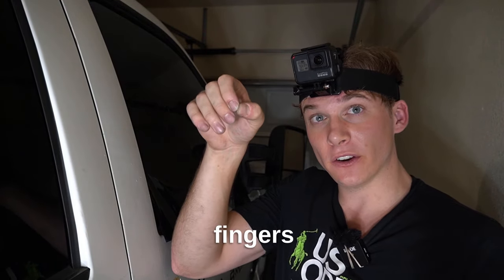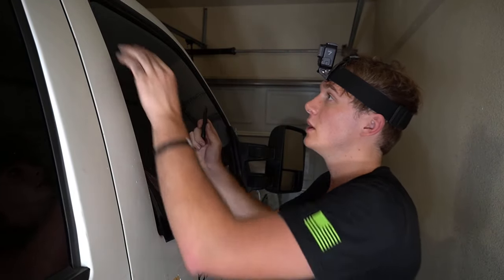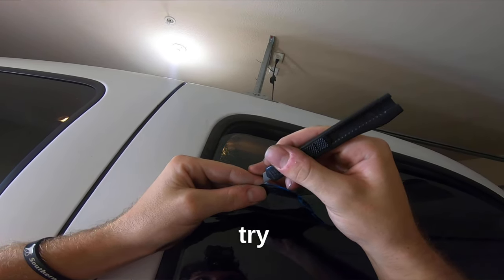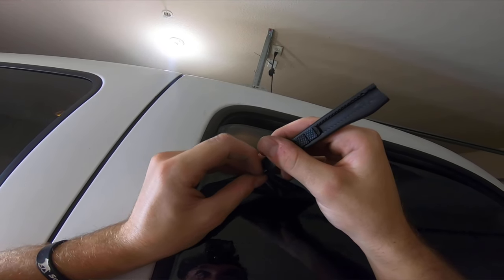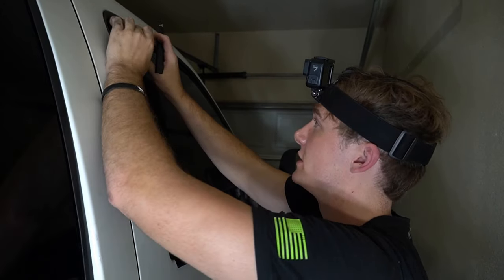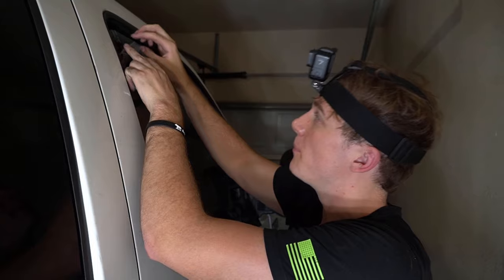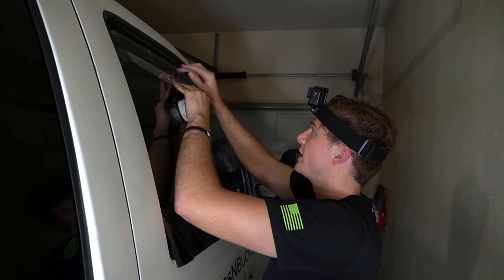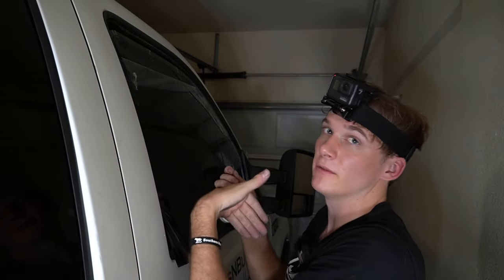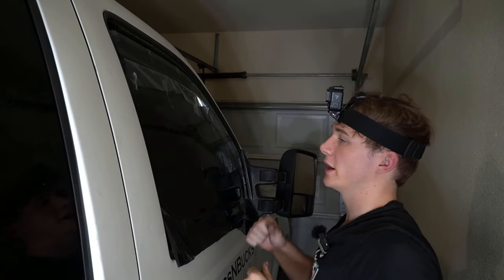What the guy says online is that you can get in there with your fingers and peel the film back — false. No way. I sat there for 10 minutes trying to peel that film back. What you're going to do is take this razor blade — it might be a little sketchy but it's the only way I found. Take the razor blade and find that groove in there. See, super easy — seconds to get that film off. Now we're not going to remove the whole thing. We tape it with scotch tape — pull it back an inch, peel it back, tape it. The tape is attached to the same film, so when you pull the film off the tape goes with it. Now remove the top tapes, pull it off, and stick it on the window.